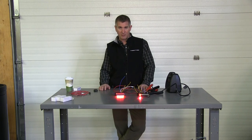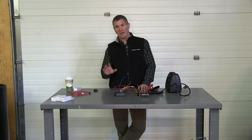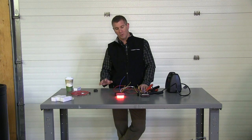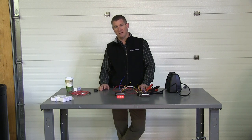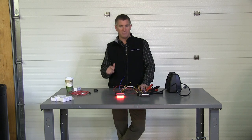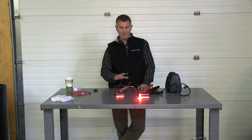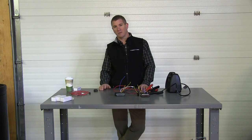Before I do that I just want to mention a couple quick tech things. Don't bench test unless you absolutely positively know what you're doing. Most lights that come back here that we have to refuse for warranty were bench tested and damaged. Battery chargers, batteries sitting on your workbench, jump boxes — it's okay for us to use them here, we know what we're doing, we've been doing this for a very long time. Please don't do it at home; install them per the instructions and follow the instructions to the letter.